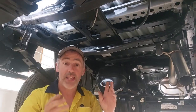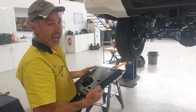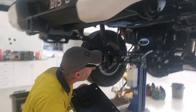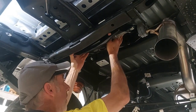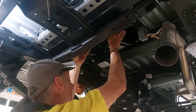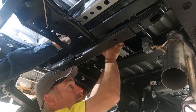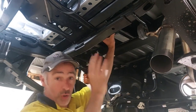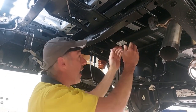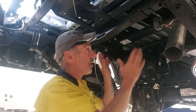Now we're going to put in the centre box. We grab the centre box — the handle goes on the driver's side. We're going to run it up there over those two 5/8 bolts, rattle it in, and then poke the neck up through the hole in the floor. We've got another guy to pop that bolt in there. It's all loose at the moment because we've got to measure and make sure all the bracketry is centred — you know your hole is centred, and you've got the bracket centred now.